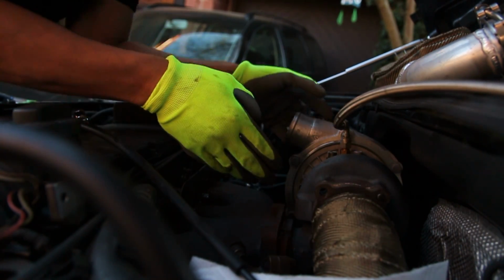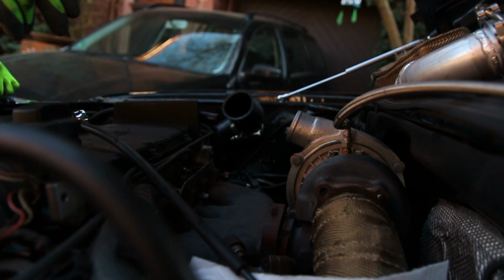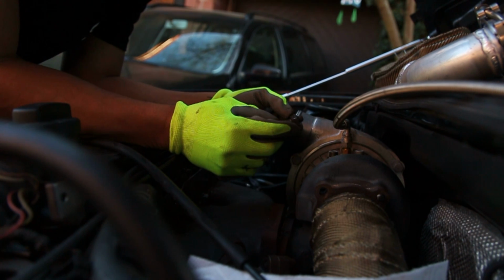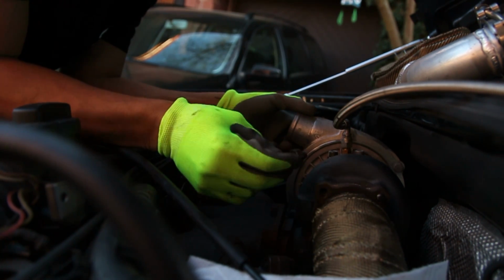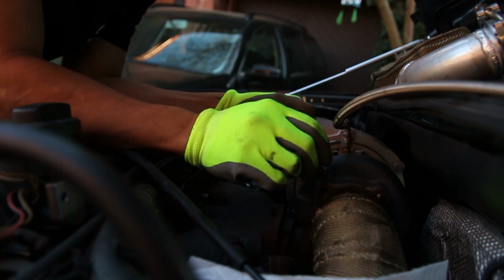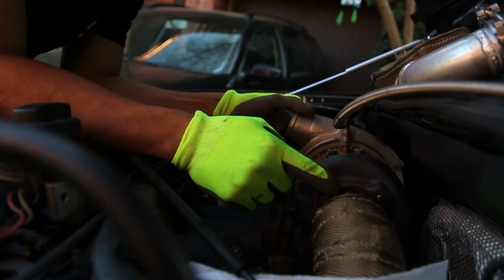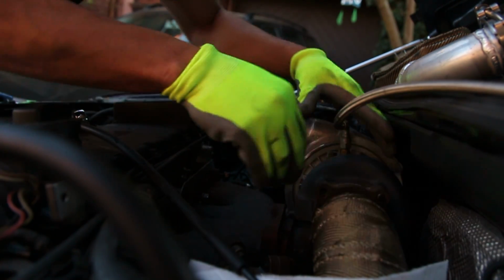Oh, maybe not. Hold on. So the irritating part is, half of the bolts for the turbo here, the nut came off with the stud. So I would just be able to pull it straight out. So 3 of the 4 of this one came out with the stud. The 4th one down there, the stud stayed in. And then over here for the downpipe, 2 of the 4 studs came out and 2 stayed in. So one of these has to go, because now I'm kind of stuck between both. I might be able to wiggle it this way enough though.